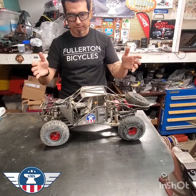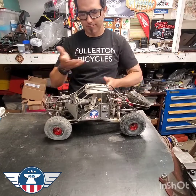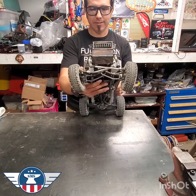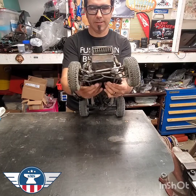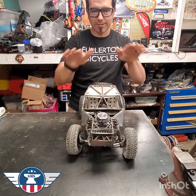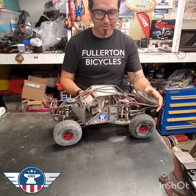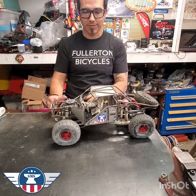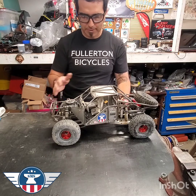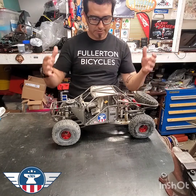What's up, everyone? Alright, gonna do a rig review on our Gatekeeper Prerunner. So this one we did attack the beams. This does have twin I-beam suspension, so it's got that nice goofy camber and toe change throughout the travel, just like your classic Ranger Prerunners. That took a little bit of figuring out to get it right, a couple of changes and renditions there. But overall, this is kind of like your typical Prerunner.